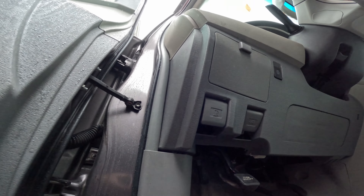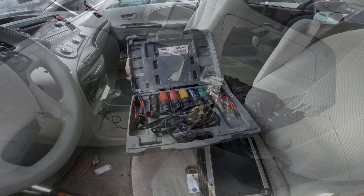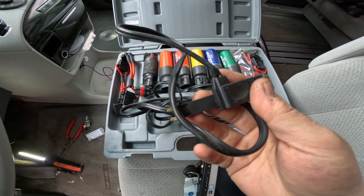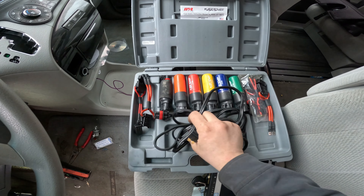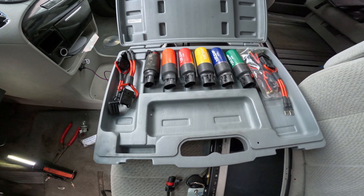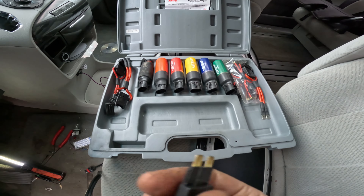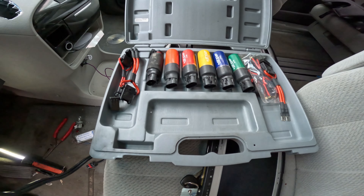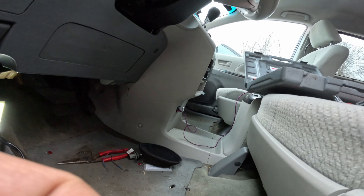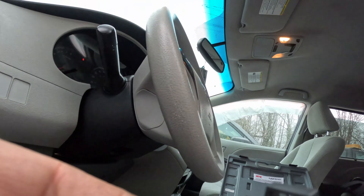It's a 4-amp test light, so it will light up brightly if it's a dead short. I'm going to use this kit — actually I'm just going to use this piece in place of the fuse. Problem with this kit is they don't blow as quickly as they should, and I've even seen smoke once, so I'm a little scared to use them. I'm placing this in place of the fuse so we don't have to sit under the dash all the time.